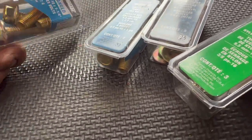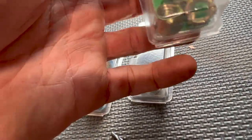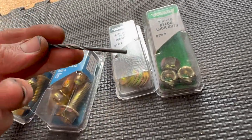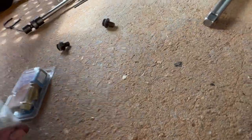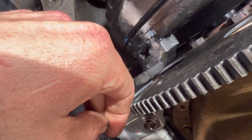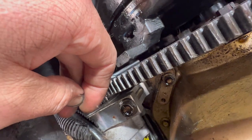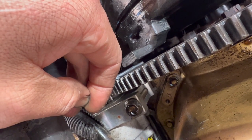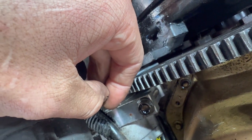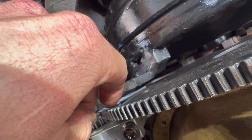We had to run to the parts store. We got bolts in two different sizes, some washers for our spacer, nylon locking nuts, and our drill bit. This drill bit is going to be what spaces everything out. So I'm going to scoot under here — this is our gap, and what you do is stick this eighth inch drill bit under there and then add washers to fill that gap. It looks like it's probably going to be two washers. That's the gap you're pulling the converter back from the pump, and there are three bolts.